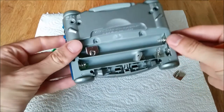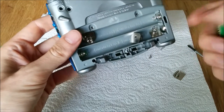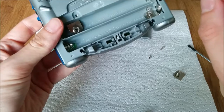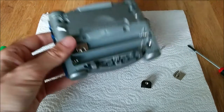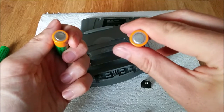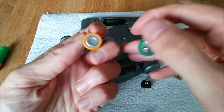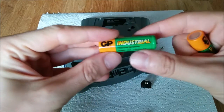If you open up the Digi-Blast, you find the normal springs where the batteries fit in, and also additional springs — these little plates which have springs attached to them. So they put extra pressure on the batteries. The result is, you see here a normal battery with a slight bottom, and here you see the imprint of the little pin from the other battery. So it's deformed, and that can't be good for that kind of rechargeable battery.